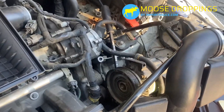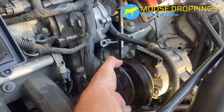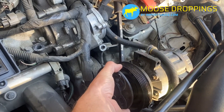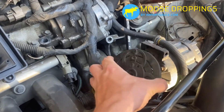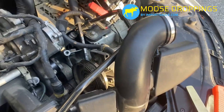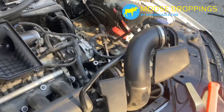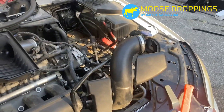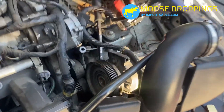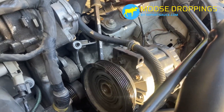With the car running, everything is spinning except for your face plate — your face plate is stationary. Turn the AC button on, come back out and look. When the AC button is on, this face plate should be locked in and spinning with the pulley — that's what activates the AC compressor. If that is not happening, if you're not hearing a click or seeing that engagement, then it is probably the actual electromagnetic clutch in there that's just burnt out.